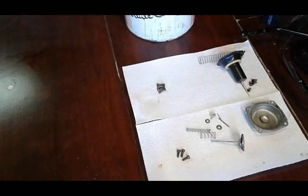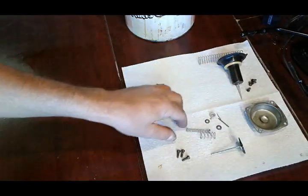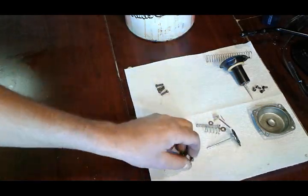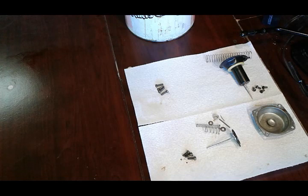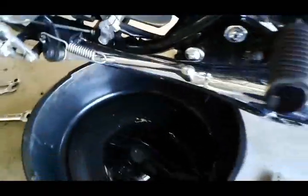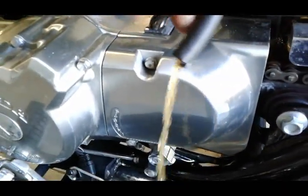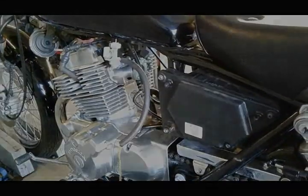While I'm waiting for my solution I organized my parts - you should always do that. I've got bad habits, I do this all the time so I know where stuff goes. This is for my float bowl, this is the top of the carburetor with the four bolts and spring, this is all for the acceleration pump and the three screws for the acceleration pump cover. The other thing I'm gonna do while waiting is drain this gas tank - I've got a little oil pan here. Yeah, the color of this fuel doesn't look too good. Got it on reserve, drain all this out while waiting.